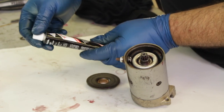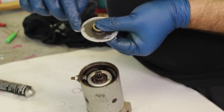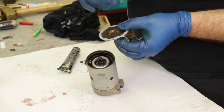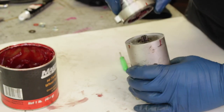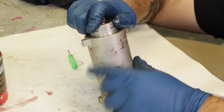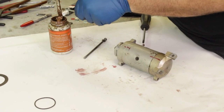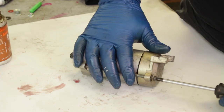It really doesn't need much. In our case since we're unable to use the gaskets, this RTV is more than adequate to seal up the starter motor. You really want to use an RTV type compound for this — take it and spread it very thinly on the edges that need it. Whichever part you're not using a gasket for, make sure you have a little bit of this on there. Once we did that we reinserted the plate into the starter motor, put the top housing back on, and checked our gap again. This time our top cap snaps in really nicely and there's not even really a visible gap. Now we're going to take the long bolts, put a little bit of anti-seize on them to make it easier to open up in the future, and tighten it back down. There's no specific torque value for this, but tightening them as much as you can by hand with a hand screwdriver should be plenty to hold it together.